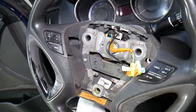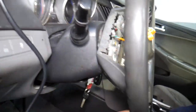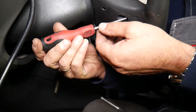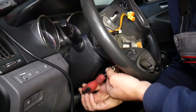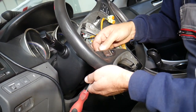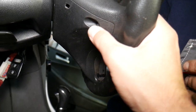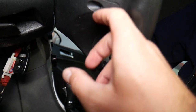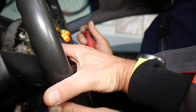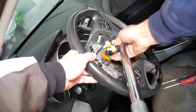That's how we remove the airbag. Putting it back together is pretty simple — install everything back. If the airbag has deployed, you'll need to inspect the system, replace wiring, and replace the clock spring as well. Once you remove the airbag, you can see that the switches attach with a screw on the back side. Let's find the exact screw size and remove that screw. This is for the volume button — the cruise control will be exactly the same.